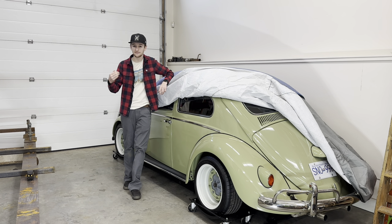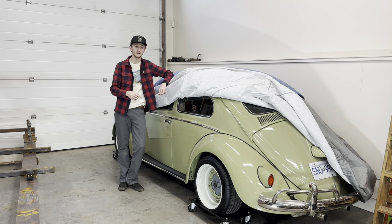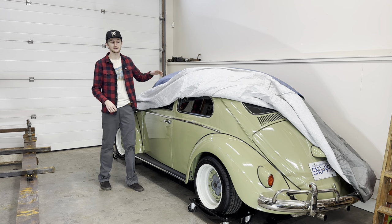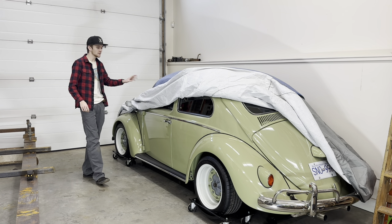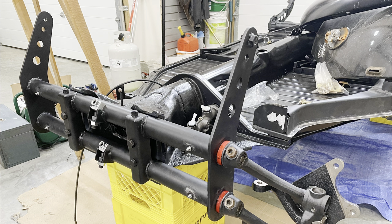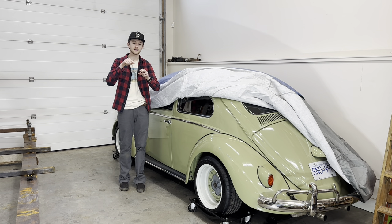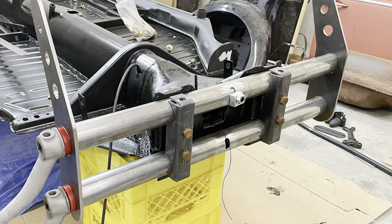Now I'll tell you about the one step further you can do, which is what I've done on this car — I've combined both steps. This is what makes it so you can have adjustable ride height. Starting in the front, you can buy — I'll put a picture up — they go in the middle of your front beam. It's a bolt that goes through an aluminum block and into your torsion bar, and the hole you have to cut on your front beam has to be oblong so that block and screw can move up and down.